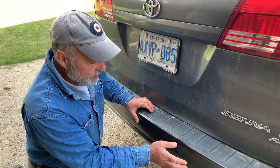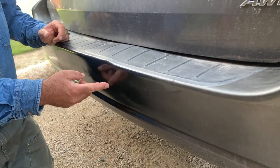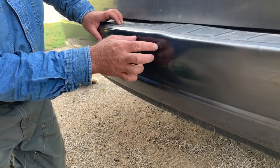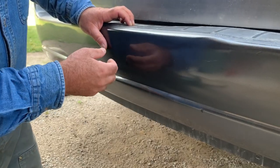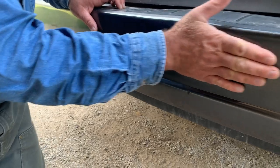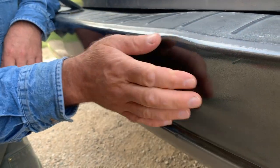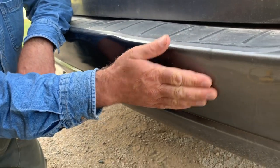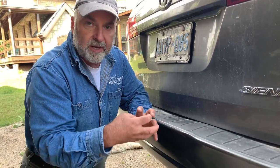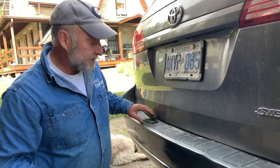The color and clear coat has been on for three or four days now and it looks pretty good - certainly a lot better than it was. The paint is actually very slightly darker than the stock paint, but the stock paint is 15 years old so a perfect match isn't realistic. I want to refine it further because even though it looks fine visually, when you rub your hand over it it's not perfectly smooth - there are dust bumps, little things that landed on the paint when it was still wet. Out in the periphery there are particles that didn't pool with their neighbors.